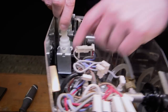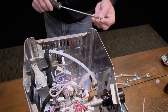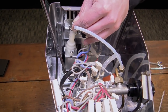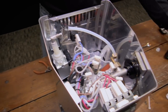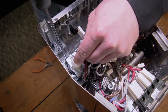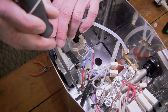Now we've got the wires hooked back up. Drop it down in there, pull a little excess tubing to make it a little bit easier, and now we're in position. Take the two screws we took out — magnetic tip comes in handy again — and line it up. You can see the hole right there on the bracket below. Start one screw but don't tighten it all the way yet because you might have to move the other side to get it lined up. Once lined up, get the second screw in, then tighten both down — just finger tight is fine.